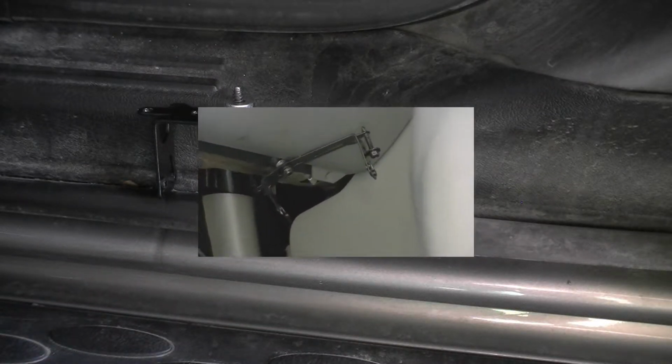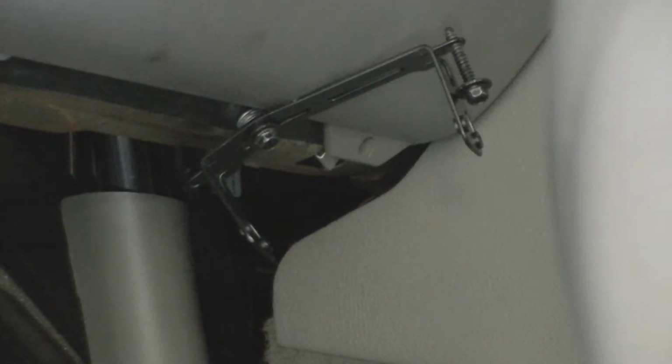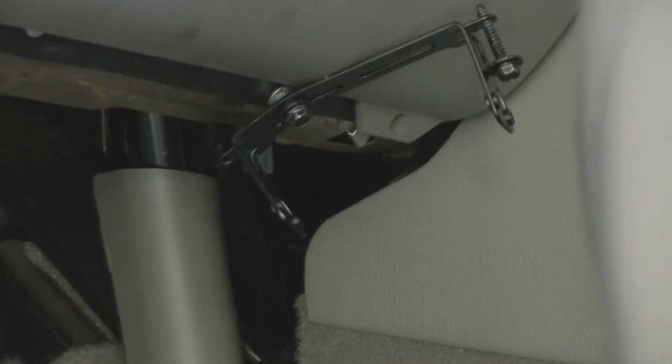That's what I like. Now, without completely tightening down the bolts that hold the bracket to the dash, I'm going to attach the 2 screws to the right side of the brake controller first, and tighten those down, because once the bracket's turned into position where it's going to be mounted permanently, you will not be able to access those screws. You'll see here in just a moment.